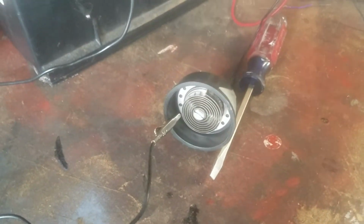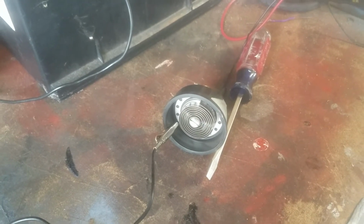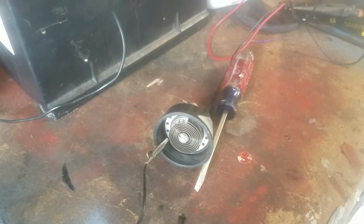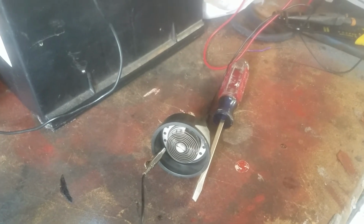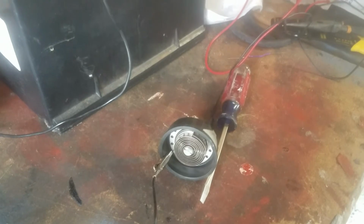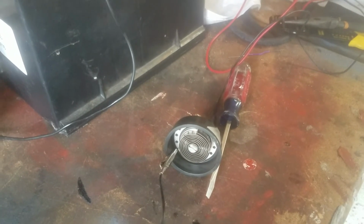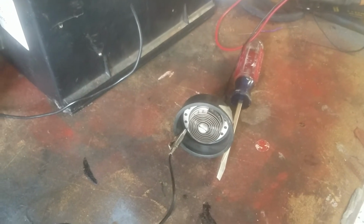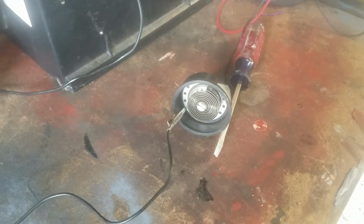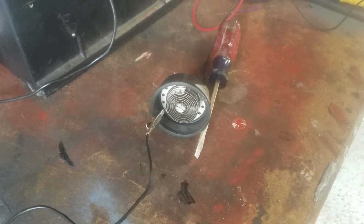Okay, so I have an 84 Mustang 5-liter CFI fuel delivery system. I've been having problems with the choke setup, with the car idling high when it's cold like it's supposed to, but not kicking down when it's supposed to after it warms up. After going through a bunch of troubleshooting steps, I finally determined that I believe the choke stove is not functioning anymore.